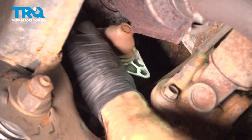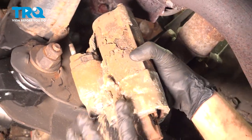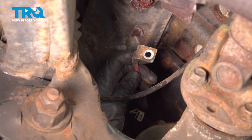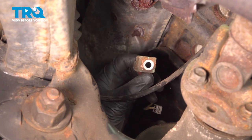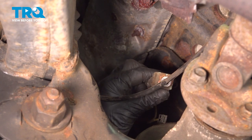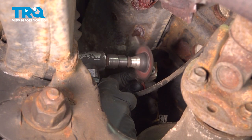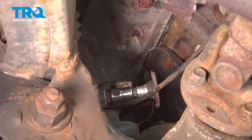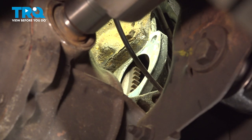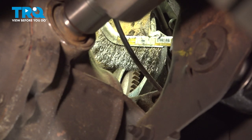There it is friends — the starter is out. Before we continue installing our starter, it's time to do a little cleaning. We'll start with the wire. You'll notice on the larger wire, you have the metallic tab that goes directly against the starter. It's important to make sure you clean both sides. Once you've cleaned both sides as well as you can, continue on to the transmission bell housing where the starter is supposed to go — make sure this is a clean, smooth surface as well.